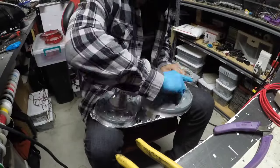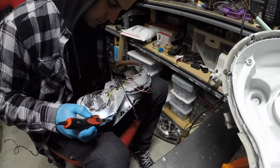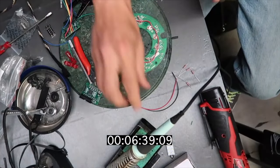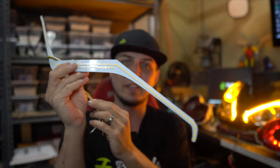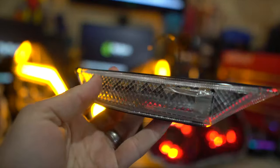We can modify factory lights, and that's what I'm showing you in this video — how to take the original LED lights, some tail lights for the GTR, and make a really cool sequential setup with them. We can also do circuit board lights where we take control over all the different little LEDs. Or, just like in my last video, you can use these drop-in LED strips and take full control of them with the sequencer. This drop-in panel was made for the Nissan GTR. You can do taillights, headlights, even side markers — controlling those LEDs in any order.